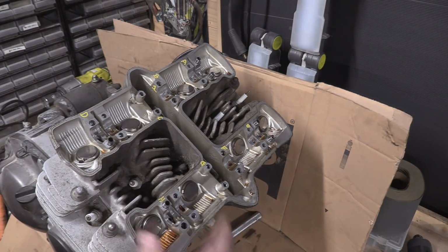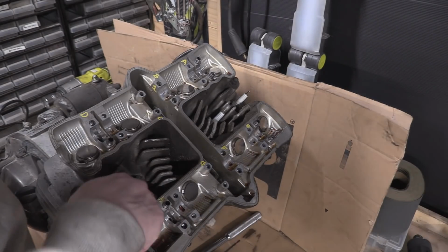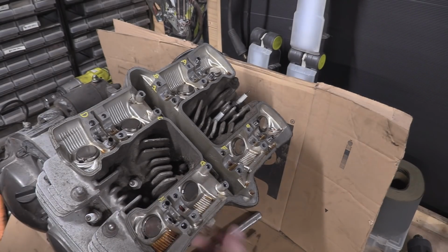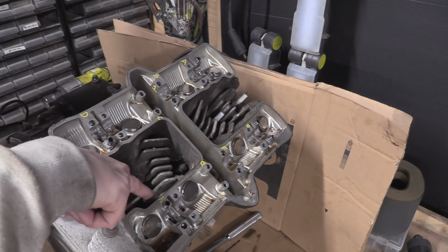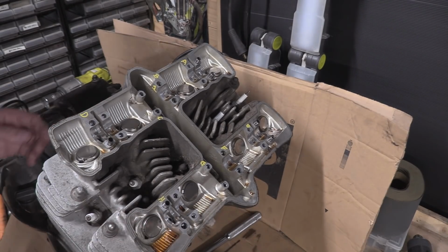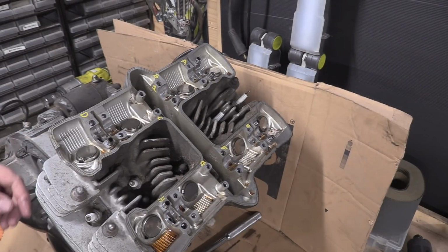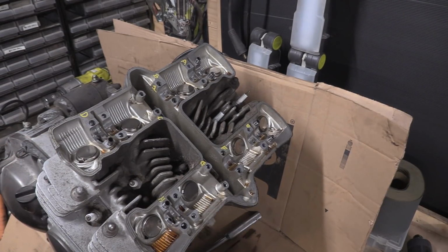The reason why they're there is this is going to get covered in water. A lot of engines have them. On the ER5, it's a little hole that's been drilled. On the SV, I think it's a little hole that's been drilled. These castings are a bit nasty, to be quite honest. Another hole there. Right, so these head studs are all M12s by the look of it.